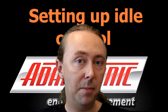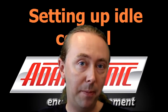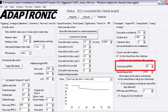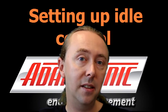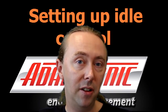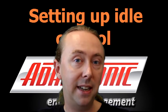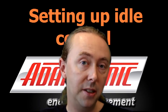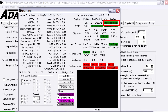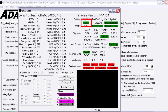Once those conditions are selected, the other condition for closed loop idle is that RPM must be less than the target plus the control band RPM. If the RPM stays above this value for up to the neutral timeout period, the ECU will go into closed loop idle anyway — which fixes the case where the engine is idling too high. This condition also prevents the ECU entering closed loop immediately after a free-rev; it waits until RPM comes back down to idle first. Additionally, the ECU will only go into closed loop when the throttle is closed — you can check the closed throttle flag and the idle flag in the F11 window.